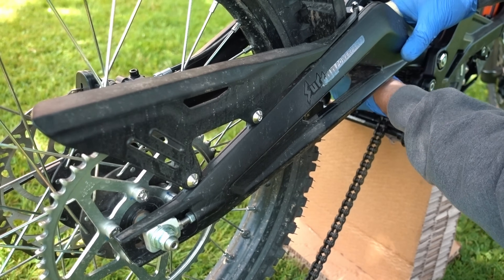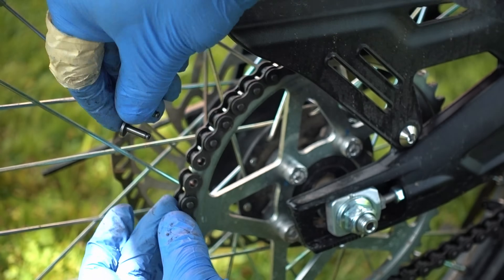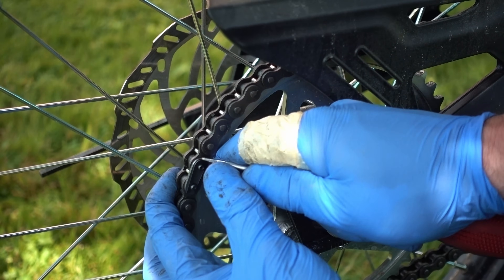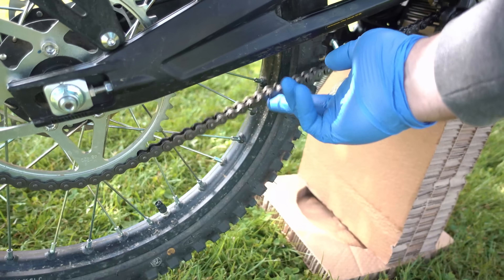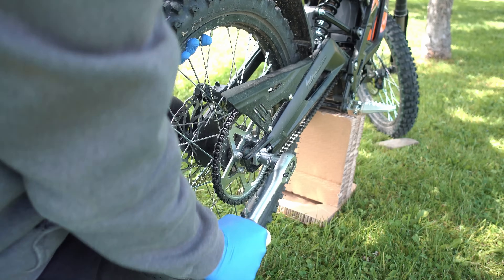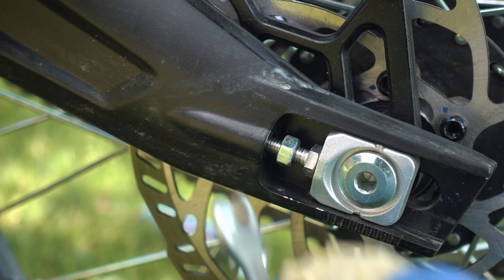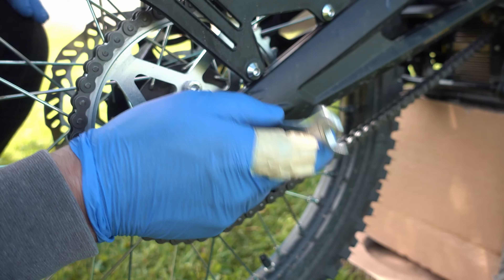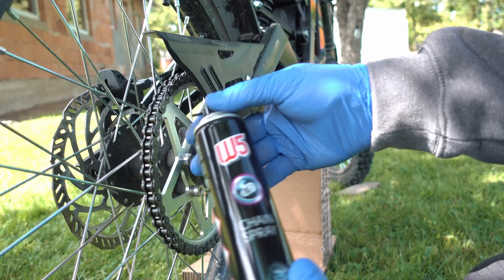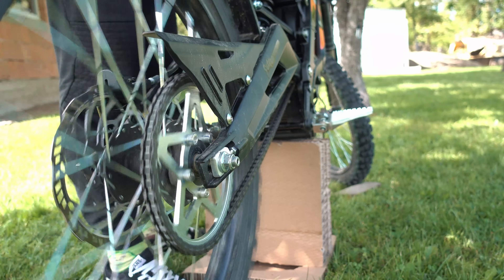Let's feed the new chain on the jack shaft and then on the sprocket. If I counted right, it should fit just fine. Time to join the chain. Chain is on, and next is to tighten it. Get a 6mm Allen key on the left side and a 17mm socket on the right side and loosen the nut. Unlock the 10mm nut on both sides and unscrew the 10mm screw a bit, again on both sides equally. Tighten the nut, tighten the locking nuts, check the chain tension, lube the new chain, and test spin it — always test spin it.